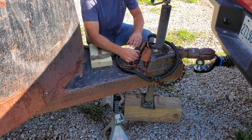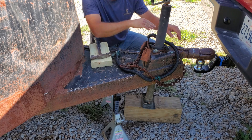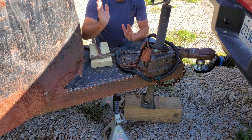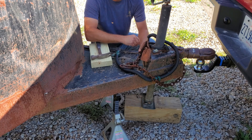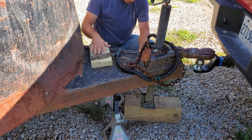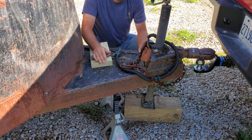You can see what I'm dealing with — this whole stand is trying to pivot and it's wanting to roll forward and it's already hit the hitch. As soon as I pull away this trailer is gonna want to roll forward and fold this jack under it. So what I'm gonna try to do is pound a couple of boards into the wheels to chock them and keep it from rolling forward, then lower down on the jack stands. Once I get it down on the jack stands I should be able to take this off — I may just have to replace this jack completely.